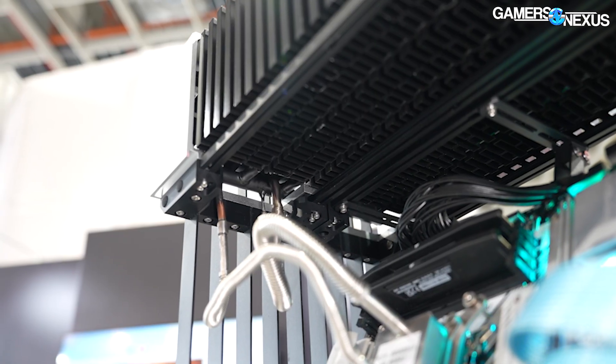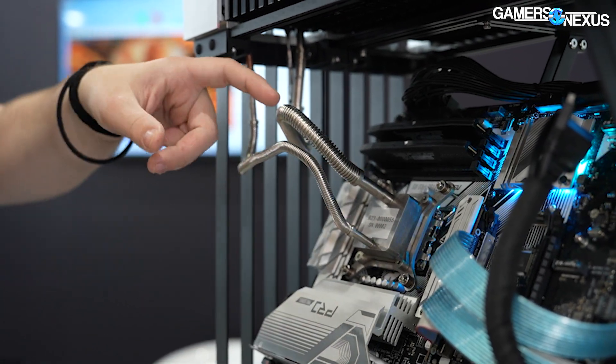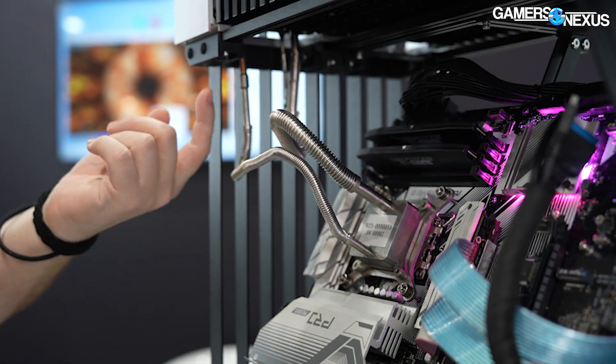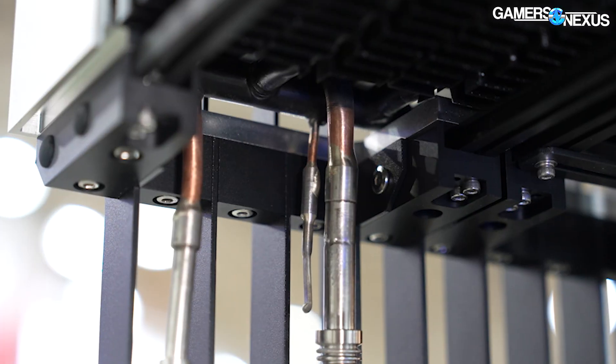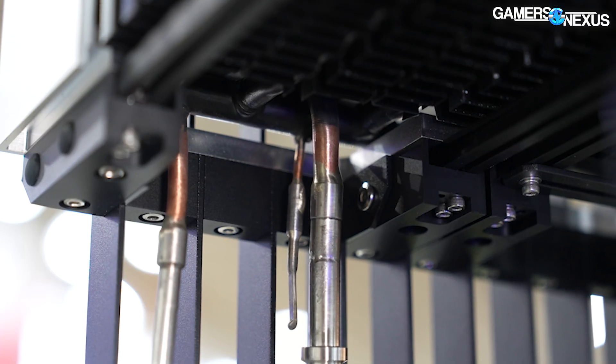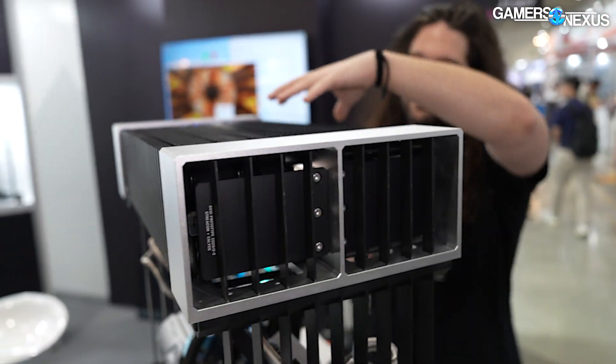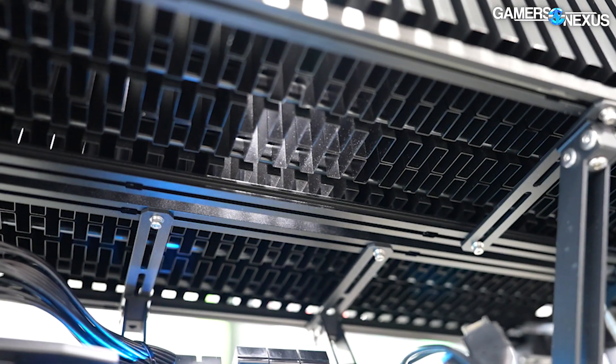This is pumpless — it does have a refrigerant, but it works entirely through natural physics processes. There's an evaporator and a condenser side where liquid evaporates, rises as vapor, and hits a pair of tubes up top. I kept accidentally calling them heat pipes, but they are not technically heat pipes — they're copper tubes. There are four discrete tubes that make multiple loops back and forth, carrying either liquid or vapor depending on where they are in the pipeline. The distinction is simple: heat pipes have a sintered weave or mesh inside, which isn't needed here. Those loops run back and forth through a massive aluminum fin stack.